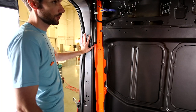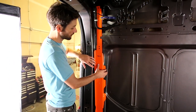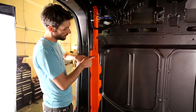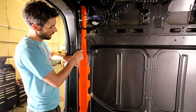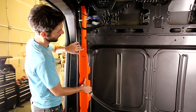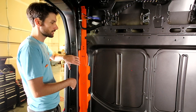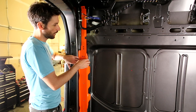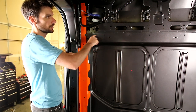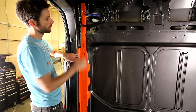We've moved on to TH2, the rear vertical piece right inside the rear door. Same as the TH1 piece, there's going to be a factory hole that we need to index from. On TH2, basically where you see 'TH2,' the next rivnut hole up is the hole we're referencing — there's a factory hole just behind that we'll drill out and set our first rivnut. That lets this piece hang in place while we do the rest. A quick measurement check: you can use the horizontal line as a reference against a similar connection point at the front.